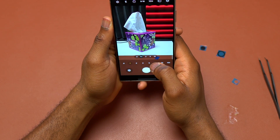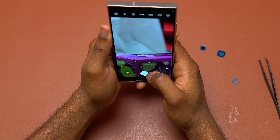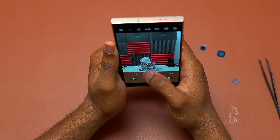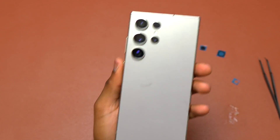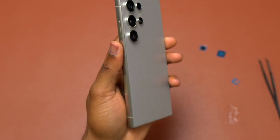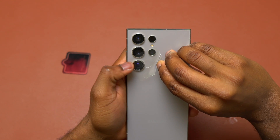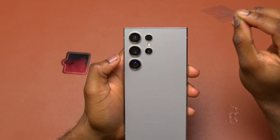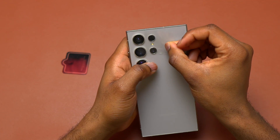After you've done all this, you need to test the cameras again to make sure that everything is working perfectly. Make sure that all the cameras are in focus, especially the ones where you replaced the camera lenses. In place of a heat gun, you can use a common hair dryer — it can work also for camera lens replacement. And as you saw, you can do it also without heat, but it may leave some scratch on the camera rings.